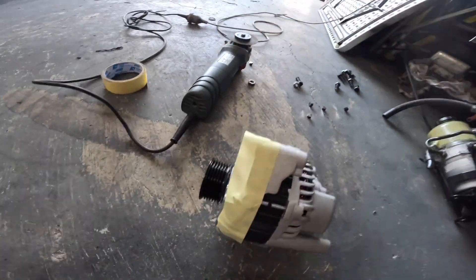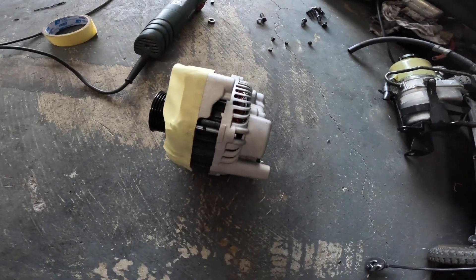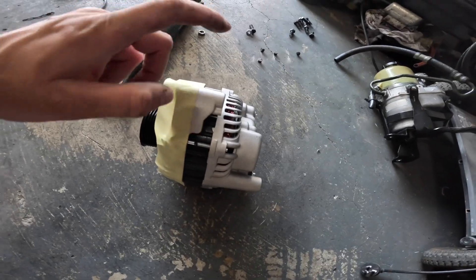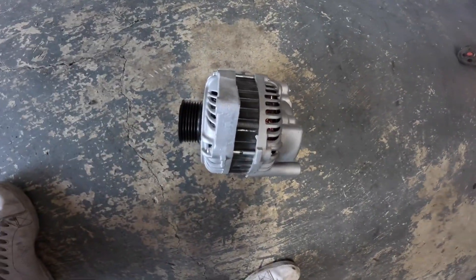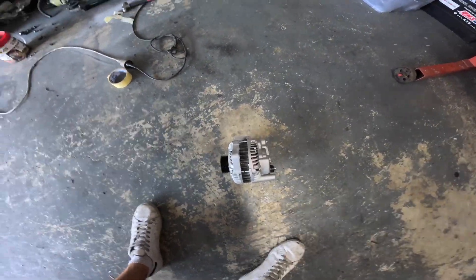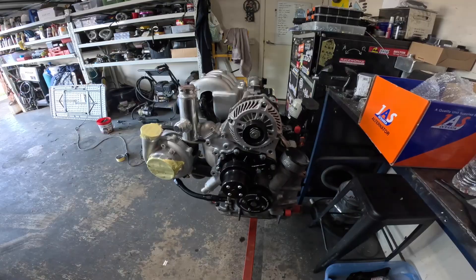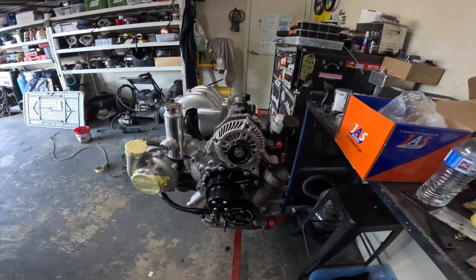You can see here we've got her taped up around that line. Pretty average tape job but it should do the trick, and now I've got a nice straight line to cut. Knock this tab off — and just like that, she's all cut off. We've got a nice straight-ish line, should be able to mount it. Just going to grab some random hardware, chuck it on with that one point, and see if we line up. And there we have it — LS alternator on the 13B.